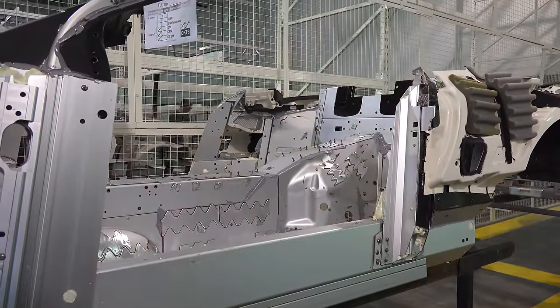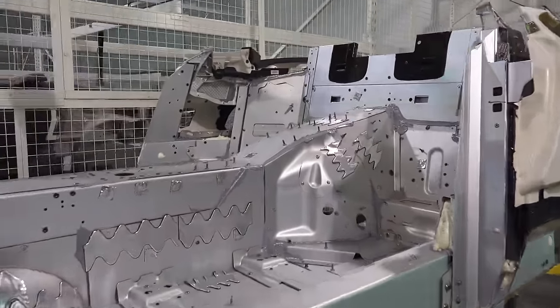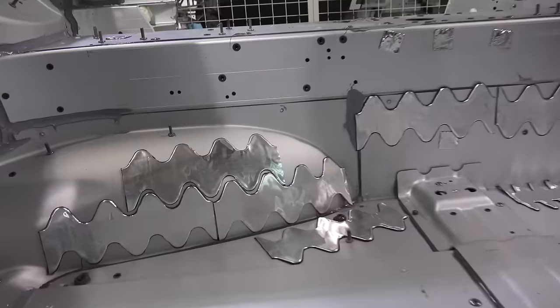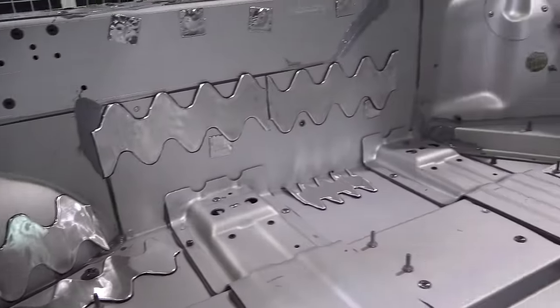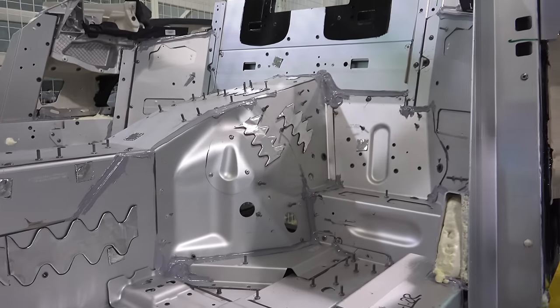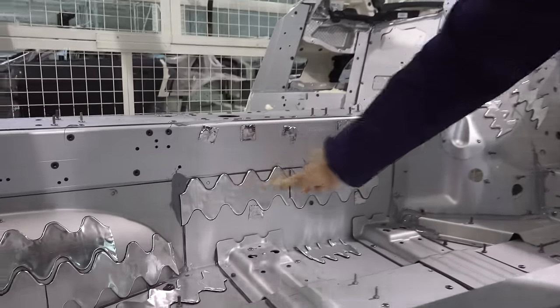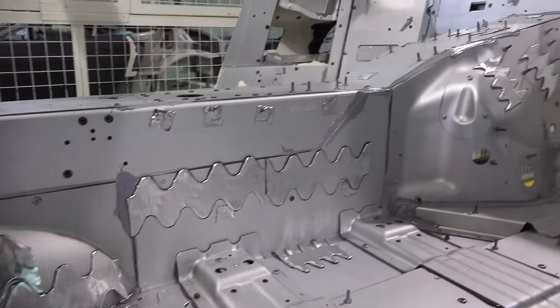It all starts with the chassis and extruded aluminum architecture, to which bonding adhesives as well as NVH materials are added. Foam is used to fill the structure to cancel out noise and vibration, and NVH materials seen in silver with a wavy cut are placed in key locations such as around the torque tube and rear transaxle to cut down on vibration. The material is similar to a putty with the idea of cutting down chassis vibration from the road, but still allowing for the exhaust note to penetrate through.